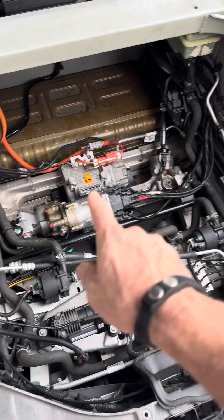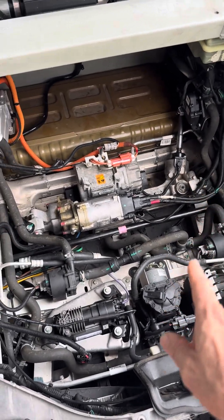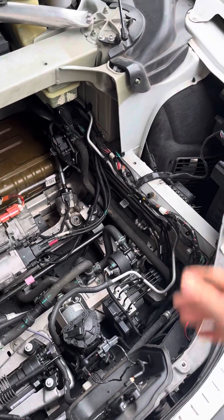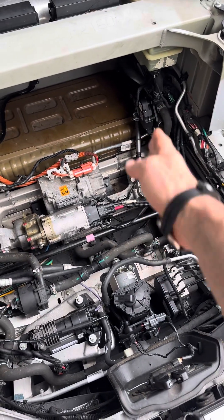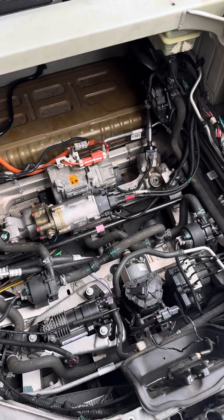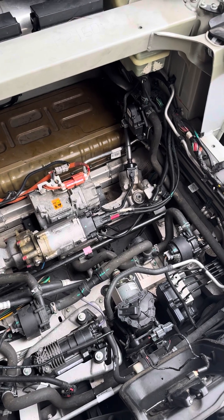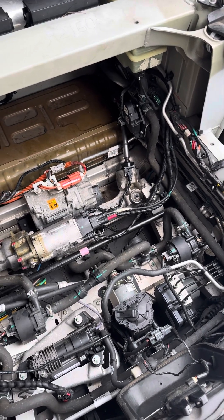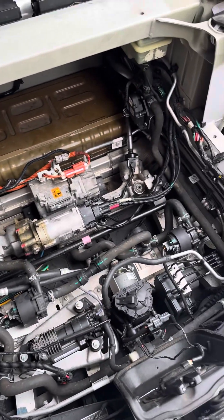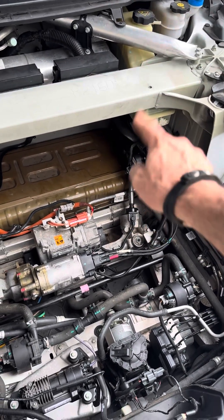That's the only possible physical way it could be like that. It corresponds perfectly with if this car had an accident sometime in its past — the steering rod would have been pretty much in the center, and those teeth would have gotten damaged, causing the steering to be very notchy and ratchety only around the center. Completely proven beyond a shadow of a doubt, because all those joints are fine all the way up to the steering wheel — they're all completely smooth.